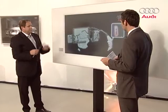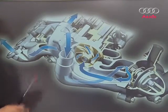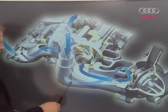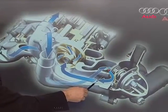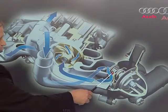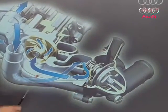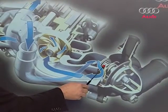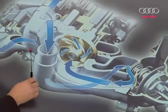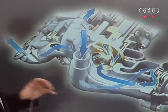Let's take a closer look at the pump. The coolant pump is located at the front of the oil pump module, all contained in one unit. The water current from the inner V runs into the pump, and inside the pump on this side we have the coolant thermostat — a two-stage thermostat. The path from the cooler is closed in a cool engine, so no coolant is flowing in the cooler. Instead the inlet back here is open, meaning the pump pumps the water internally through the pump rotor and back into the engine circuit, to both the right-hand and left-hand sides of the engine.